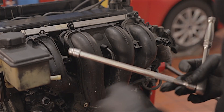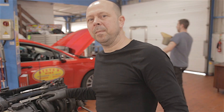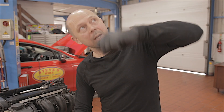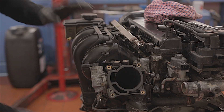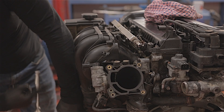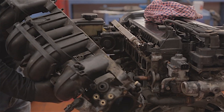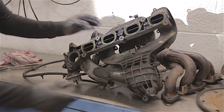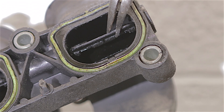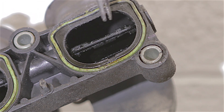I'm going to unbolt the inlet manifold now, which is just a load of 10mm bolts. If you want to see that, there's a video all about the inlet manifold and the swirl flaps — you can see that here. There's one bolt left holding the base of this manifold to the engine block — 10mm again. Let me just have a quick look at these swirl flaps. I can honestly say the bushes that they run through are completely worn out. I shall have to de-swirl-flap this manifold.